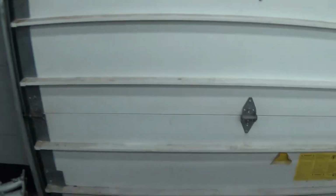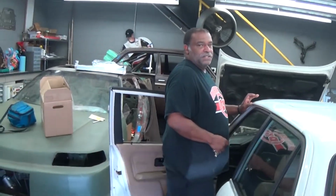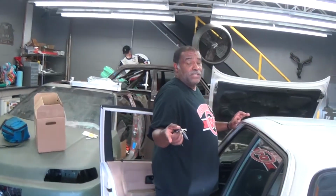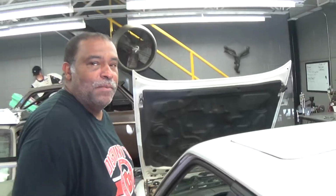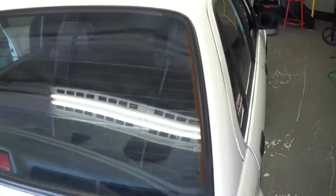Hold on, I'm gonna crack this door real quick. Mine usually takes a little more rolling over to start because of the engine management system. Jonathan's using K-Pro. The Honda K-Pro acts more like the stock ECU. With a Haltech, you turn it over a little bit more before it fires up, but that's common with any standalone, like a Motec system.